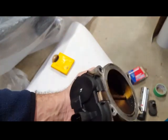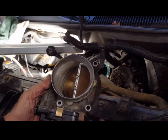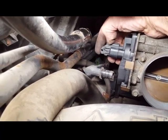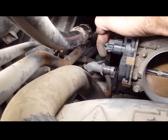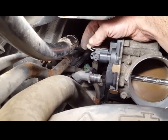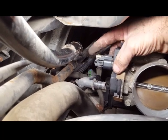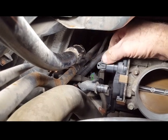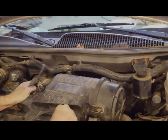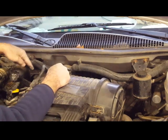I'm going to clean this up before I put it back together. This is all clean now — I cleaned the inside and got rid of the carbon. Now I'm going to plug in the plug. Line everything up, push it in gently, and you should feel a little click so you know it's all the way in. Don't forget to install your lock — make sure it goes in the proper way, and when you push it in you should hear a click. That locks it in. Let's put the air cleaner shroud back on, and now I'm going to go over and tighten that hose clamp down.